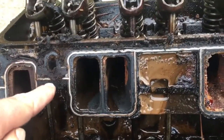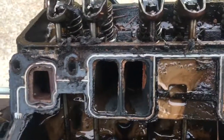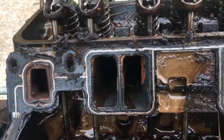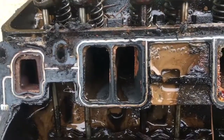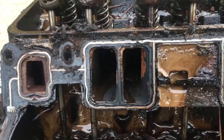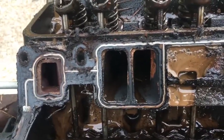Felpro has a fix. This part all the way around is metal, so the Felpro gasket doesn't disintegrate. I still wouldn't use Dex Cool though. If you change these gaskets, I would flush all the Dex Cool out and put in the old-fashioned green Prestone-type antifreeze.